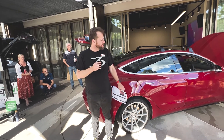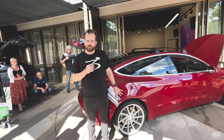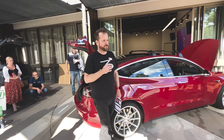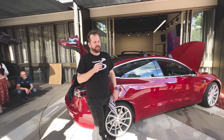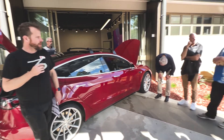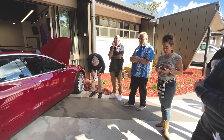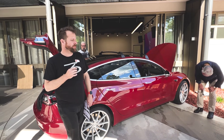Some people have had issues with the cabin filter, particularly in damp weather, getting a bit mouldy and making the car smell. If your car smells like old socks in less than two years, hassle Tesla about it — they'll give you a new cabin filter if you ask nicely. The car will not remind you about those things, which it probably should, particularly for the brake fluid.